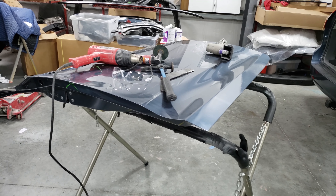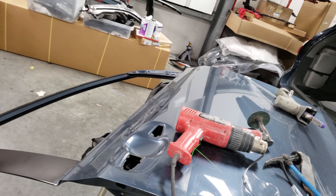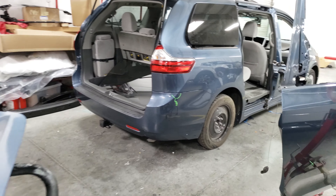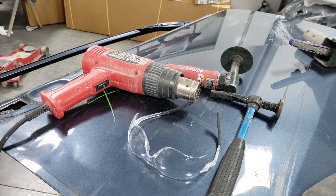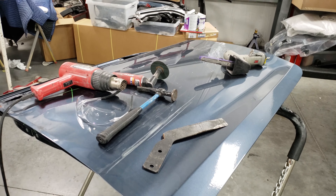What's going on YouTube, I'm gonna show y'all today how to do a door skin — or how I do door skins. I got the Sienna here, got hit in the side, it's gonna need a door skin on the front and on the rear sliding door. Tools needed: little angle grinder, belt grinder if you got it, hammer, little seam buster, heat gun or a torch — I usually use my torch but I got it at home — and some safety glasses. The heat gun's to heat up the glue on the intrusion beams. Let's get started.